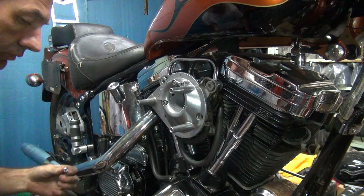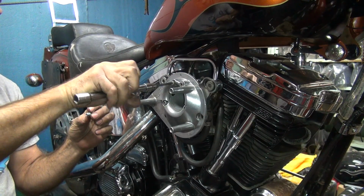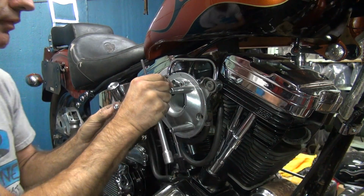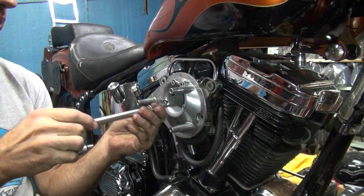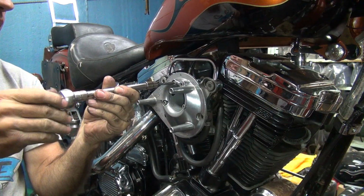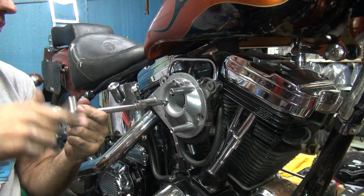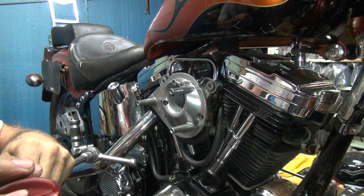Way too much Loctite on that. Spread it around a little bit. Not that I'm cheap or anything. Just don't like wasting it. Besides, if you flood it on there with the thread, it's just going to make it harder to get out. It'll be impacting in there more. A little bit of load on there I didn't like. See how the backing plate was bending a little bit?